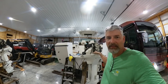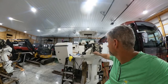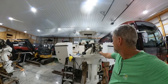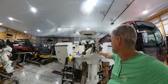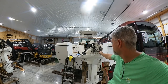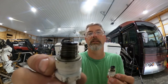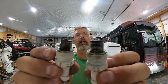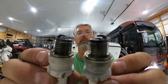All right, I'll just get these spark plugs put in here. I already know what to think about that one cylinder — I thought we were gonna have a clean sweep. I thought that was gonna be the bad motor, to be honest, but it turns out it's cylinder number four over here. That's not in firing order — I just labeled them one through six and that's the one I labeled four. I wonder what that spark plug looks like. This is cylinder number four that's got the compression issue, and this is number five — they look pretty close to the same, running rich but similar.